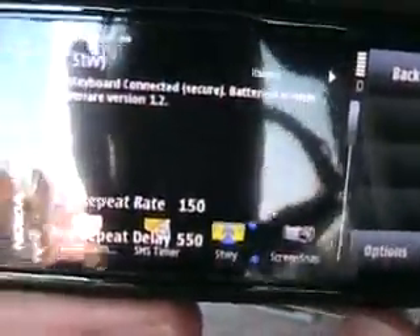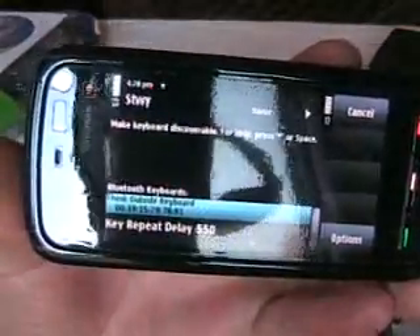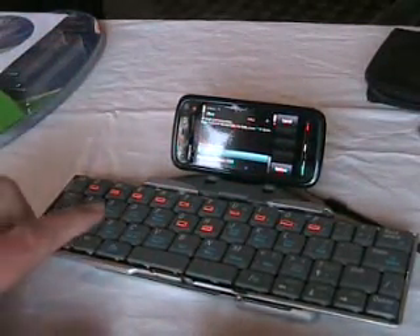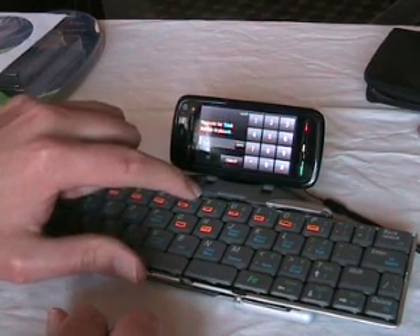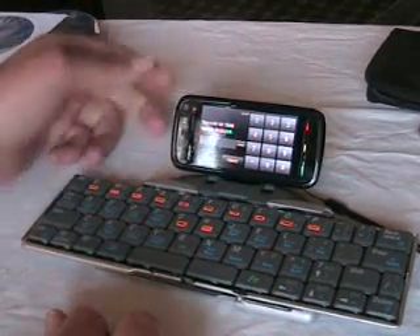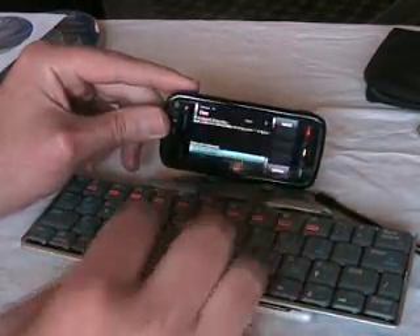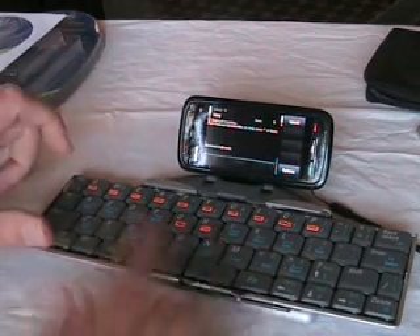So there's the little Stowaway icon. This is currently connected, so I can't really give you a proper demo. But what you would do is click on Options and click on Disable Bluetooth — it will say 'Bluetooth keyboard disabled.' Then click on Enable Bluetooth. You want to make the keyboard discoverable to re-pair it: click Control and the two Function keys. The light will flash on the keyboard a few times to show you it is in Discovery Mode. The phone has discovered it and it's asking me for a passcode — just enter anything, four 1s, and then click OK. Then hold down the Function button to use numbers and enter the four 1s.